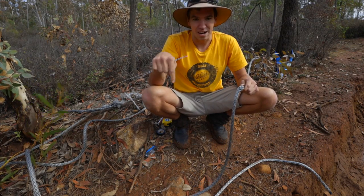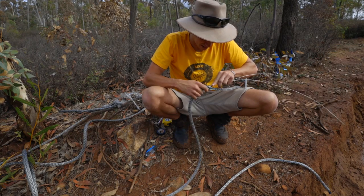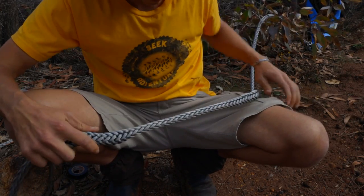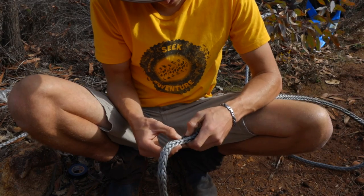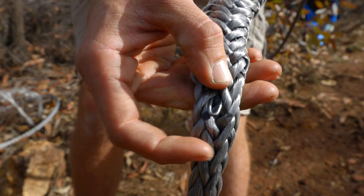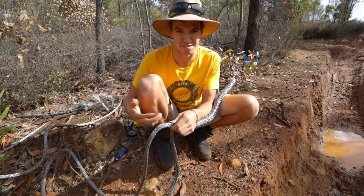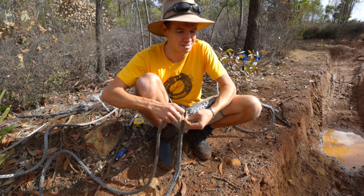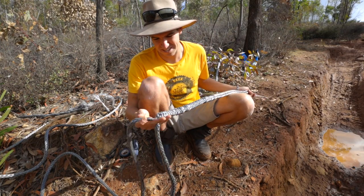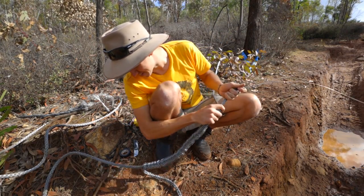About a meter and a half away from the second mark I've opened up the dyneema, and now I'm going to feed this end through until we get to the second mark — just push the dyneema apart as you feed the fencing wire through and bunch it up as you go. If your winch rope has been used a lot, the dyneema is going to be really stiff. We poke through at the mark with the fencing wire, then tape the rope end to the fencing wire and pull it through, making sure there are no sharp edges because dyneema will even catch on tape.